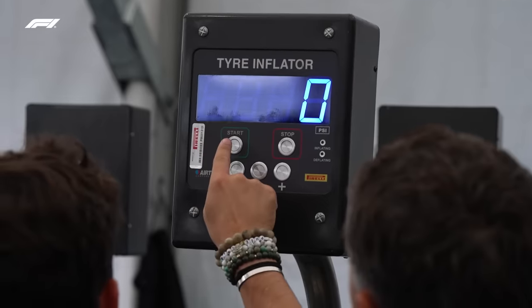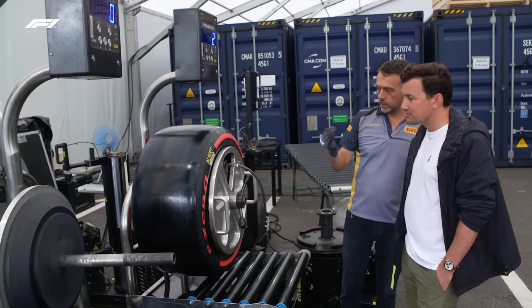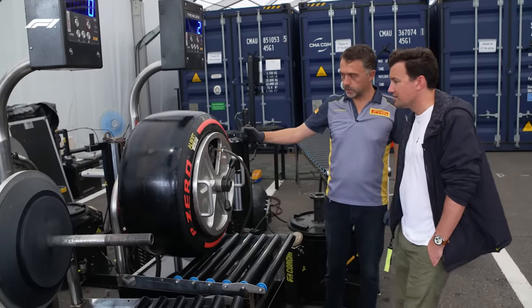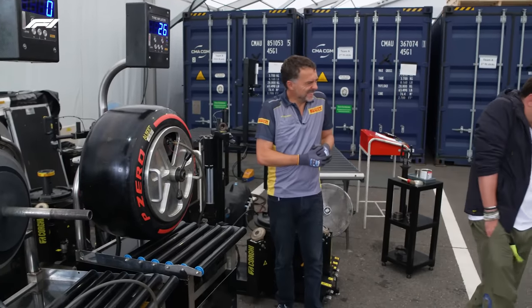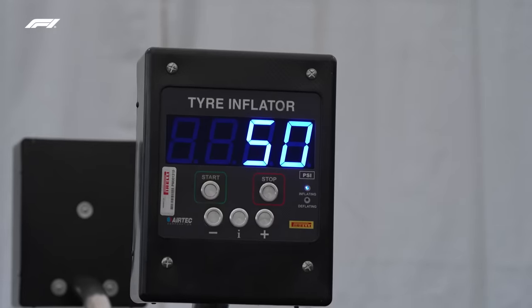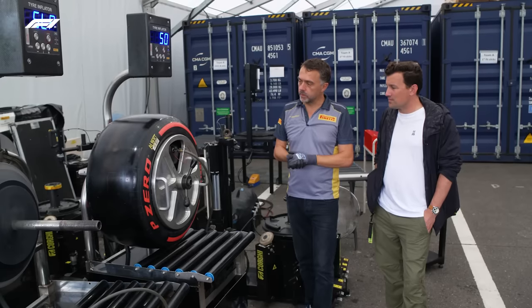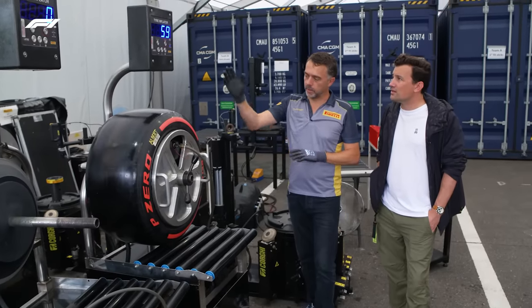Start button. Now it's coming — we'll see that the tyre is moving outwards. One side is in its place. Now we have to wait for the other side to come. It goes to a certain pressure where the machine is sure that the tyre has already touched both lips and it's completely sealed, so we can already use it properly. The procedure is finishing and now it's deflating.